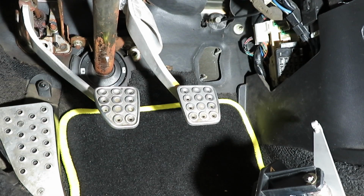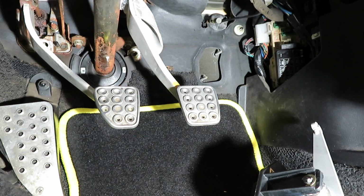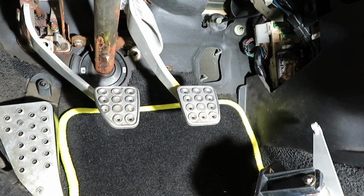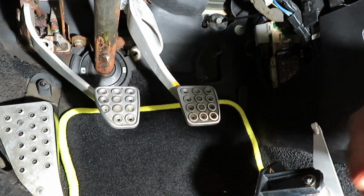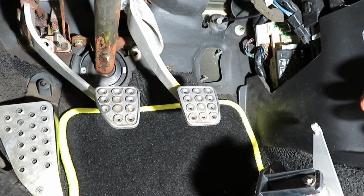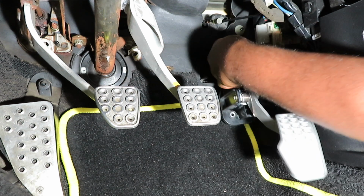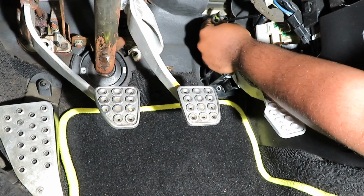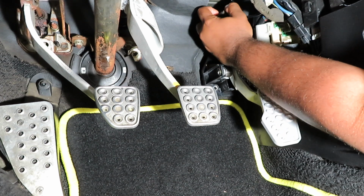Okay, remember guys, we're gonna do everything backwards, the way we took it out, if that makes sense. So the same way that you took the old pedal out, you're gonna put it right back in, okay? So very simple. We're gonna reach, sorry if it gets dark real quick, I just gotta get in here, but we're gonna start with this, with the cable on top, make sure it clicks in